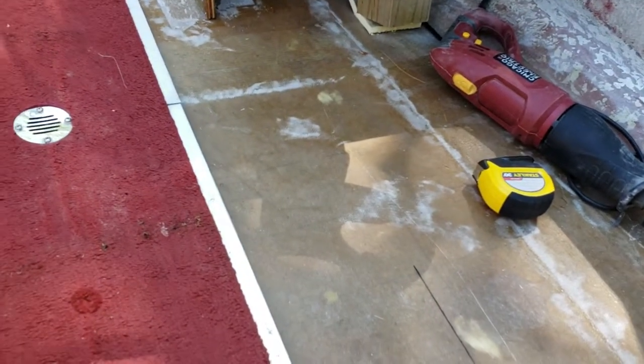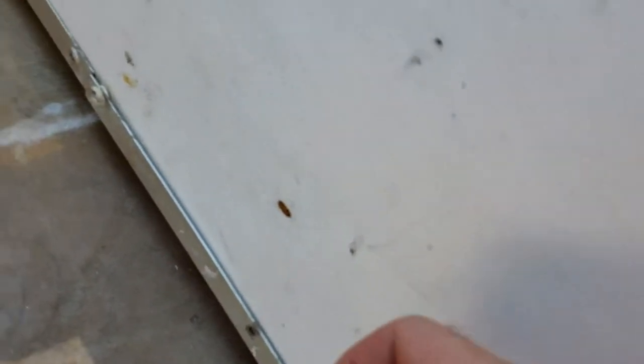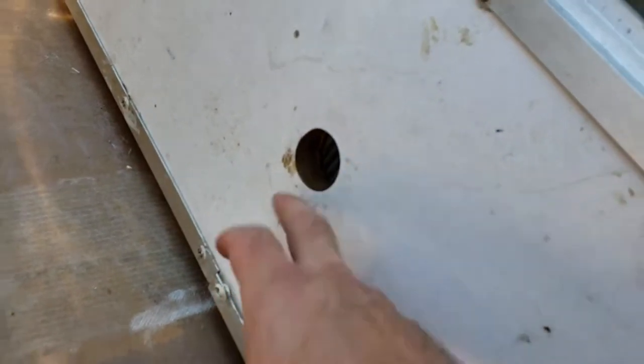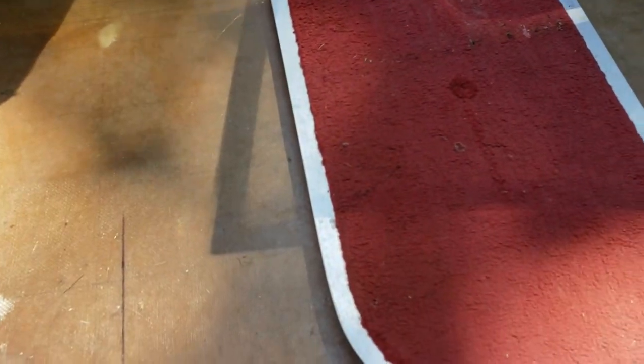What I'm going to do is just cut out the ski locker hole, and then I don't have that issue anymore because this will be screwed into the deck. The piece of wood it's made out of is actually pretty thick — at least three quarters, maybe inch-thick plywood. It's actually really solid still. They even went ahead and sealed the hole with resin — why couldn't they do that everywhere else on the boat? The wood's not rotted at all; the frame's still in good shape. It's missing a couple of screws but I can put those back in. The only thing I don't like is it literally just lifts up and out of the floor — the frame is part of the door, which seems weird. I may rethink that and put the frame in by itself.